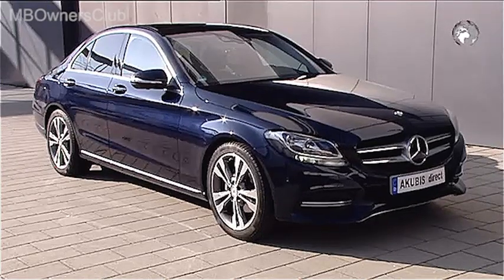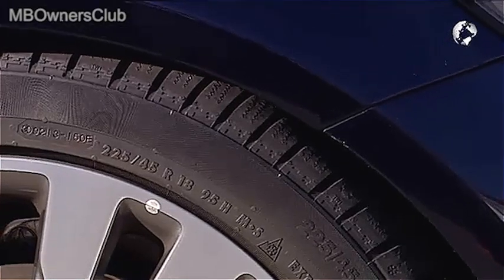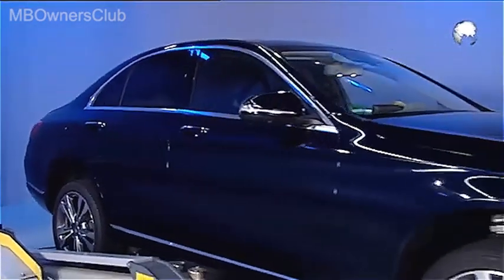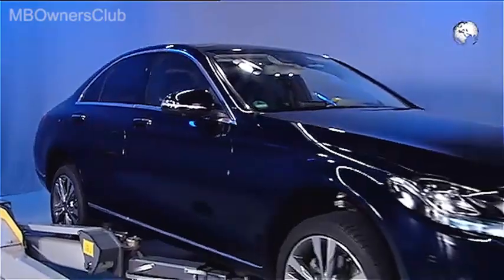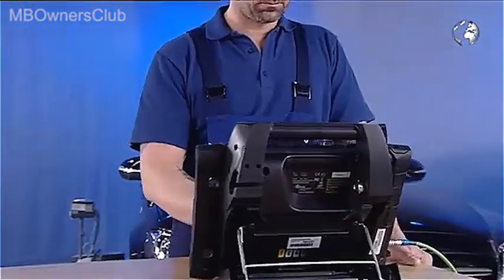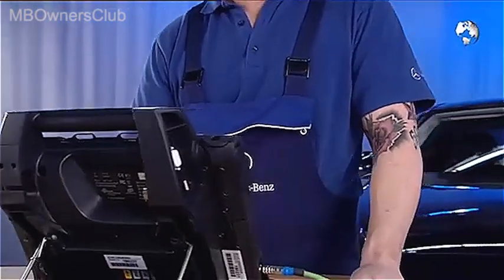The vehicle level of this C-Class has dropped on one side. After the test, you know the shock absorber has a leak. For the removal, the vehicle may not be on its wheels. Therefore, the lift is the ideal place. Using star diagnosis, completely release the pressure from the corresponding shock absorber.